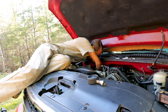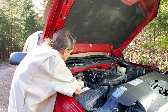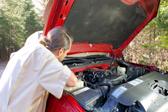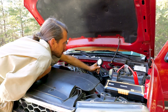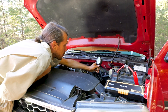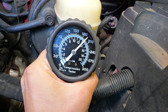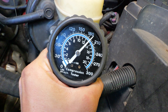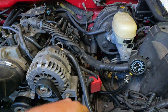About 180. Got about 190 PSI — this cylinder's good. We're at the front right here. Now we got to do those three and we'll be done.